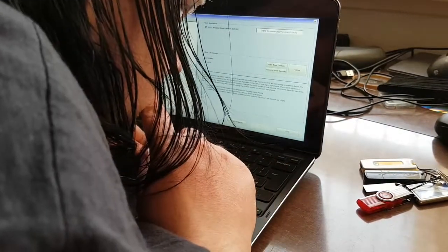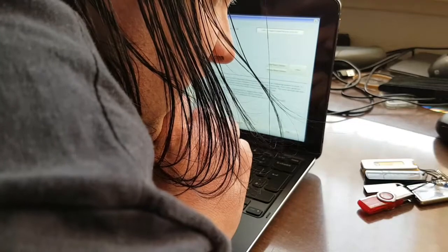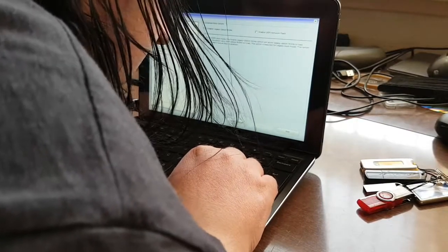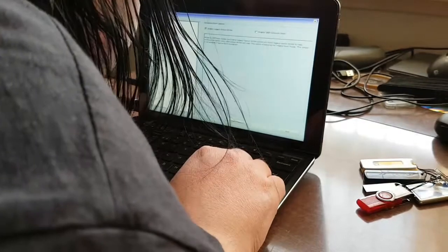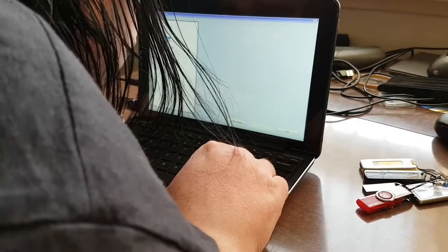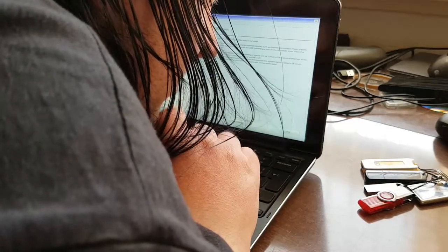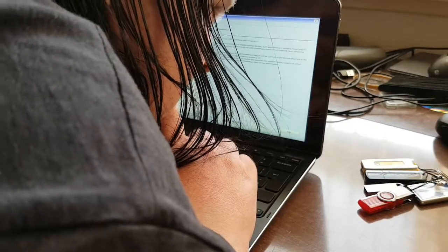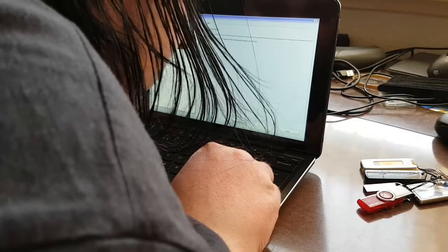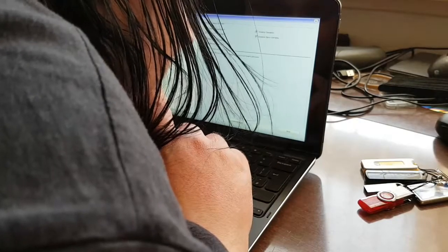Now, we've got the boot set to UEFI. Advanced boot options, enable legacy option ROMs, UEFI network stack is disabled. Date and time has been set by the guy who is out here. USB PowerShare configures the USB PowerShare feature behavior to allow users to charge external devices through the USB port while the tablet's off. Enable audio, that's good. That's enabled, that's what I want. Enable media card or disable media card.